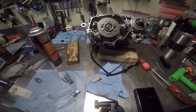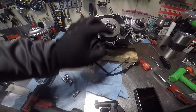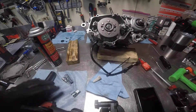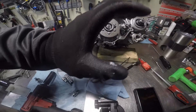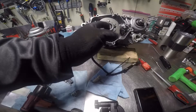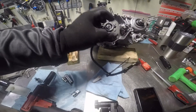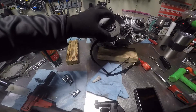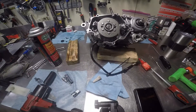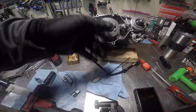Now I can torque it. Whenever you're torquing down the flywheel, you want to seat it first with either a wrench or a small impact to get it to go as far as it's going to go and set in place, and then torque it to the right foot-pound. If you try to do the torquing from start to finish you'll get false readings, because the keyway could cause the flywheel to hang up a little bit, and next thing you know the motor cranks up and the flywheel decides to set in place and it has slack and the nut gets loose and falls off.